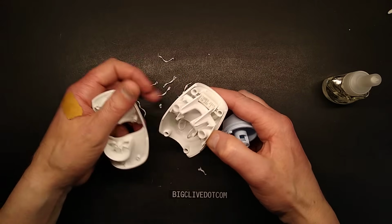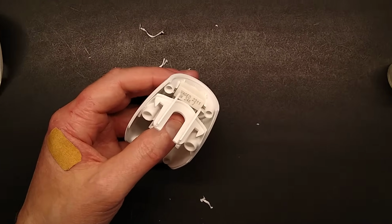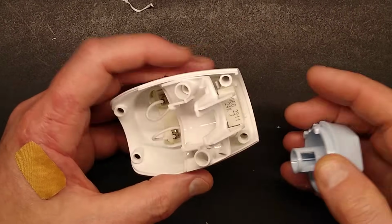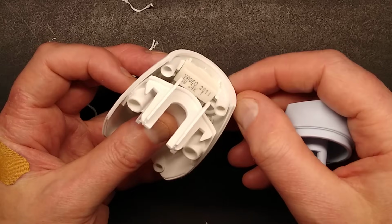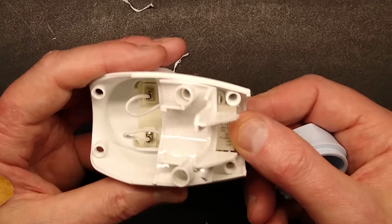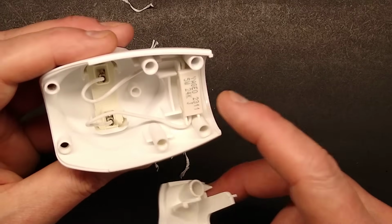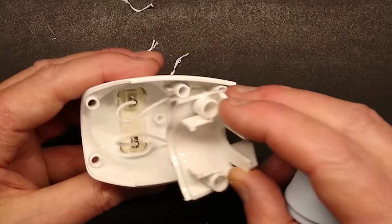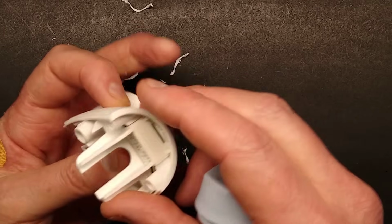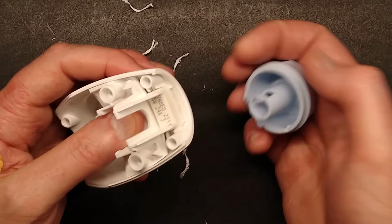Let's zoom down so we can actually see what this is here. It's using the classic resistor, 5 watt, 24K, little ceramic resistor, quite a small resistor for the 5 watt. But that is housed, it must be very heat resistant plastic. And it's got a spacer here, which is presumably going to avoid getting the oil onto this resistor.